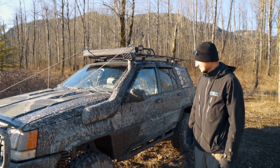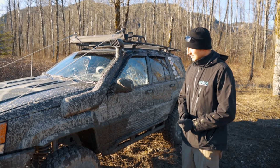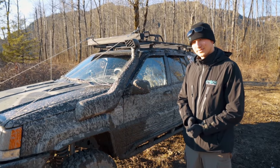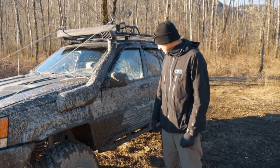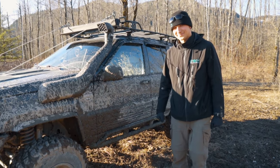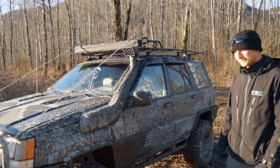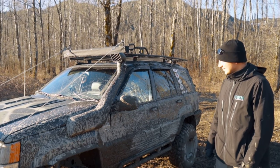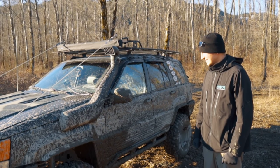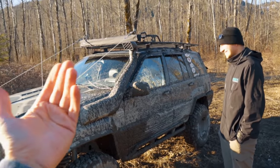You actually have the snorkel primarily for water — usually people have snorkels for dirt and dust, especially traveling in caravans. I don't do that much caravan traveling, but we've had Jeeps with the same height and no snorkels and the engines on those died, whereas I kept going. The deepest I've ever waded was probably right around door-handle height. When you're riding that deep you don't stop at all — when you start stopping, water starts coming right in. What's helping is this thing is bare bones with no tons of electronics like a modern car. The snorkel wouldn't save you in a modern car. It's that good old AMC V8 with a distributor on it — that's the benefit of old rigs like this.